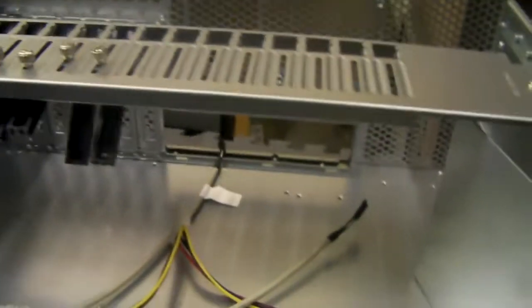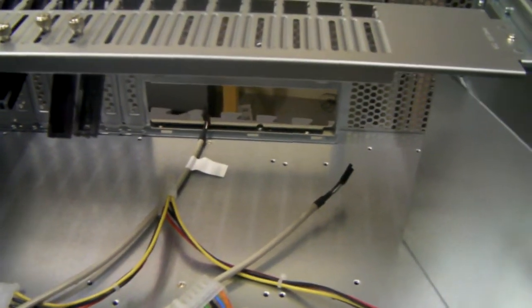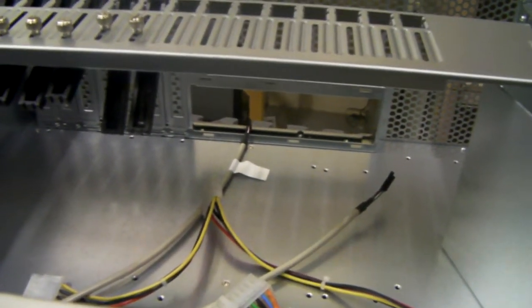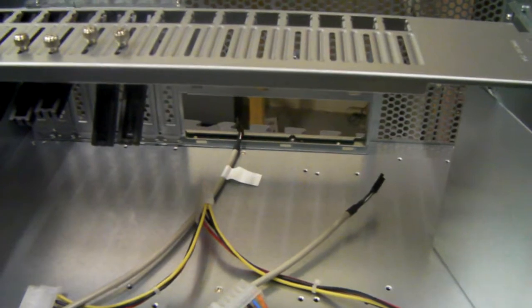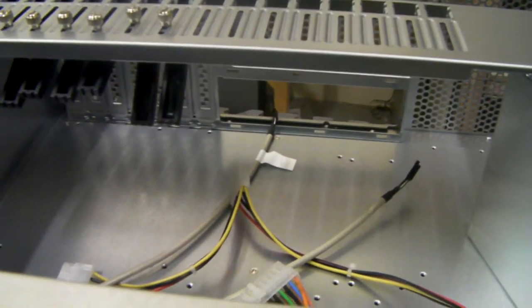This is one of the very few chassis on the market at the moment that will take a quad-way 13x16 motherboard, something like the Tyan S8812. It'll obviously also take all smaller boards — just standard and extended ATX for dual quad CPUs.